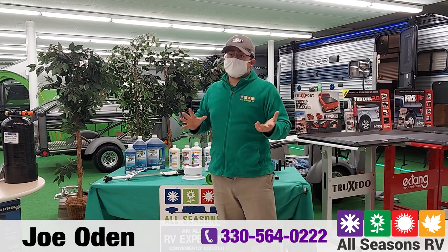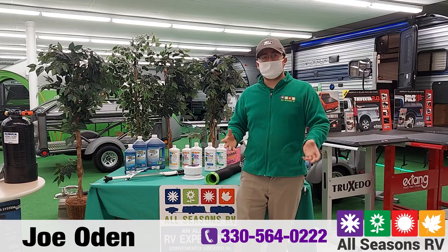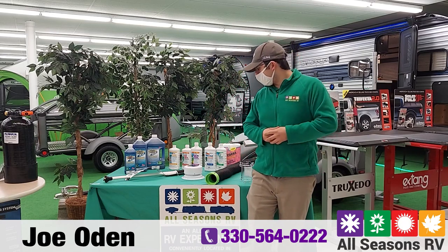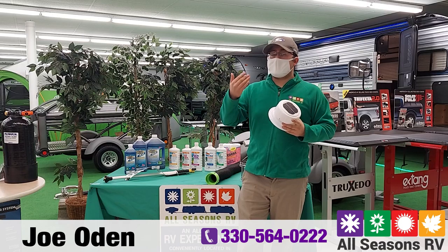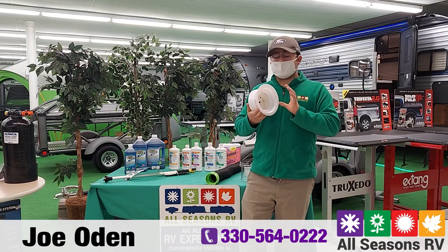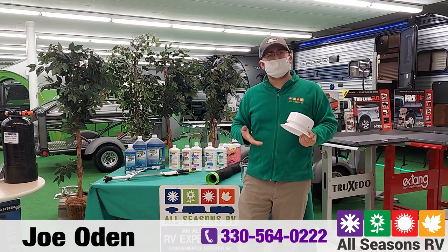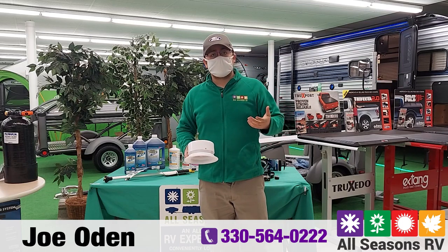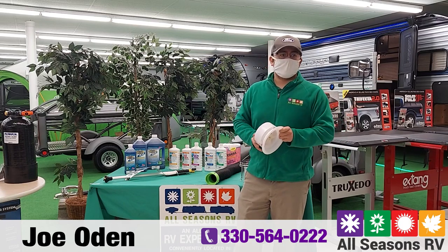At the end of the day, you will still have some odor in the tank, and some campers no matter how well built always seem to get a stale sewage smell in the bathroom. The solution is a solar powered tank vent fan. Every holding tank has a vent stack going up to the roof, just like home plumbing. This product creates a negative updraft from the tank so none of those fumes can radiate up through your toilet or through the floor. It's a very good product if you have odor control issues even when using chemicals properly.